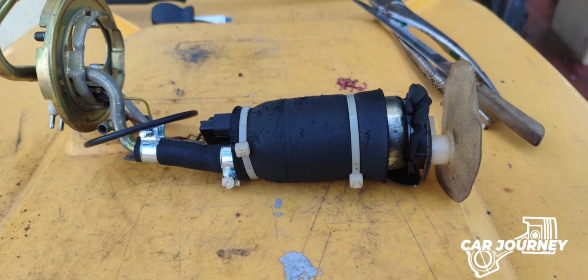Okay, so after the installation of the fuel lines, the next thing I did, it was way too dark, so this phone couldn't capture anything. But I reinstalled the intake manifold with a new fuel rail and fuel lines. I put fuel lines over both of the fittings, and then I took a piece of string to work out more or less what length I'd need, and then cut it down and set it to the clamps and everything. Yeah. All those oil stains.